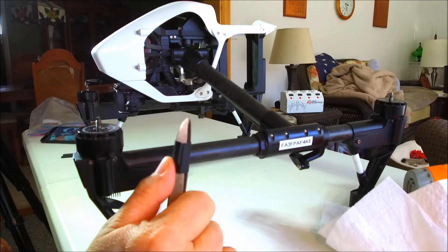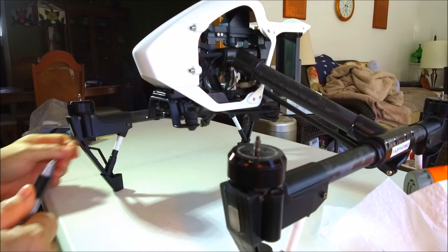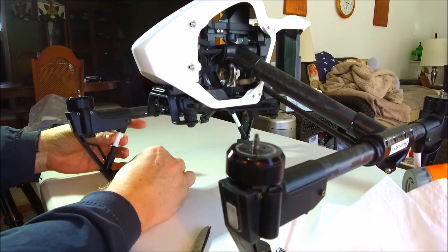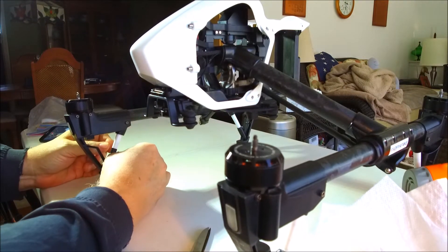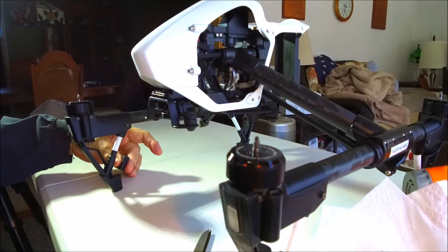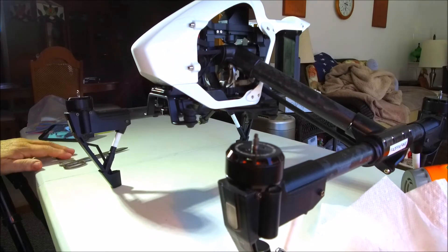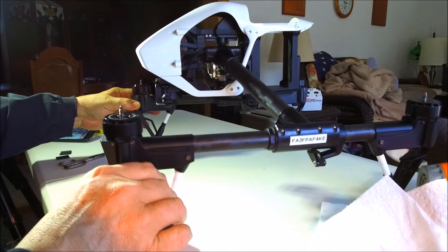With the shrink wrap, you can see on this one over here - I put it up on the tube when it was sticking out, then slid the shock back down into position and twist it until you feel it's really in there nice and firm. Then I slid the tubing down over the top until it was down on there, heated it up with a heat gun. I'll show you how I did that.